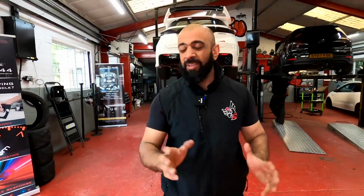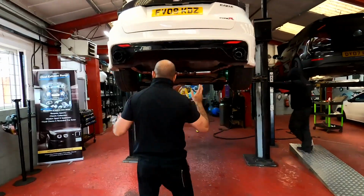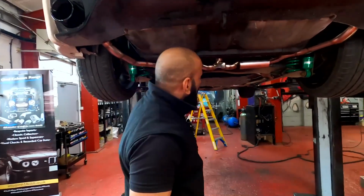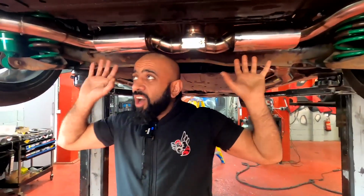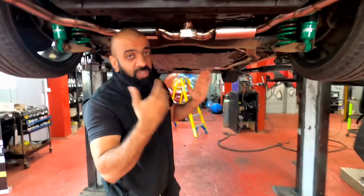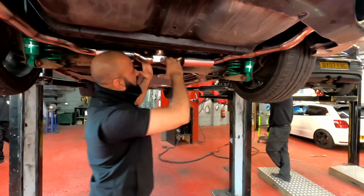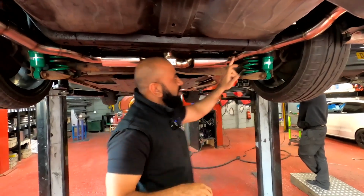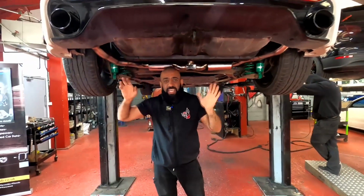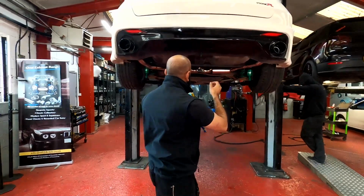That is a work of art. Even though I have to say myself, guys, have you seen how beautiful this is? Well done, Victor, you've done an amazing job. Guys, look at this. Equally, like Brandon wanted, either side we got the flow. You know the mods that we use, all oval, all the way through, 3-inch, all the way to the top, to get that equal amount of flow on either side, silence on the other side, 2.5 inch mandrels. It's amazing, guys, the spec. It took us a long time to design, but I think that is a work of art.